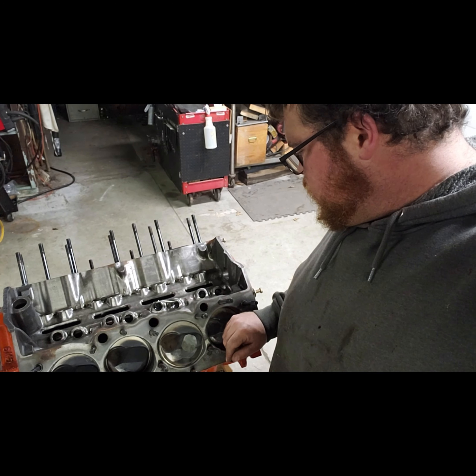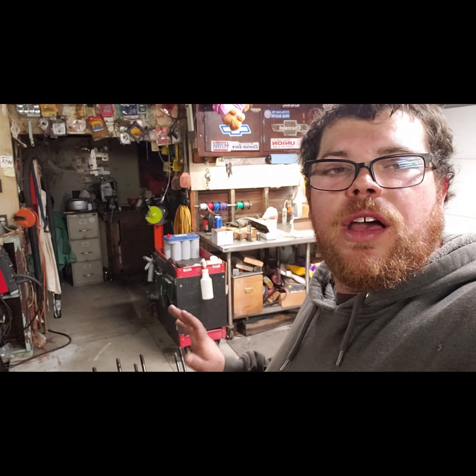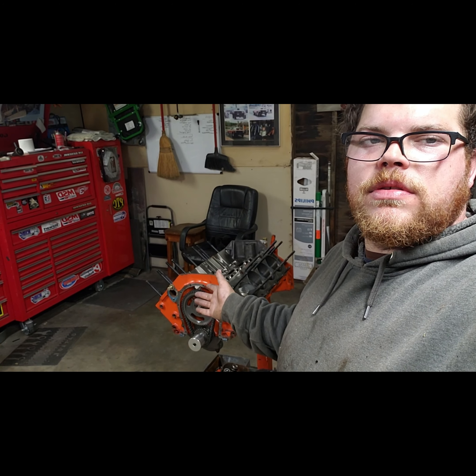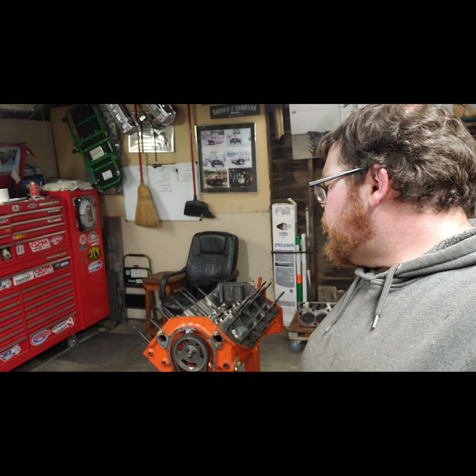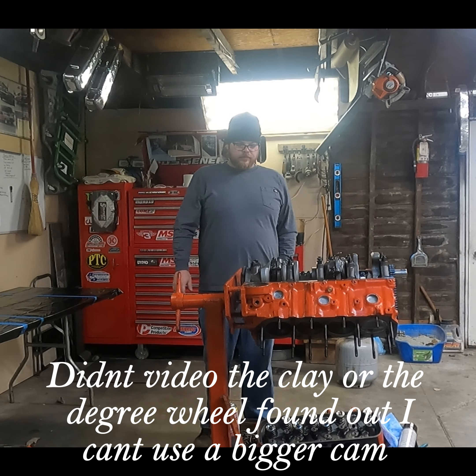I believe that's the intake side. I just stick the clay down on the piston and squirt a little WD-40 on it so it doesn't stick to the valve. If it does, I'll put some cellophane on it and do it again. I'm just checking clearance to see if I can go with a bigger cam - that's all I'm doing. Then I'll disassemble this motor. One thing I want to do first is find out exactly how much advance this cam's got in it before I disassemble it, just for tech notes. Is it 8 degrees, 10 degrees, 12 degrees? I want to know.